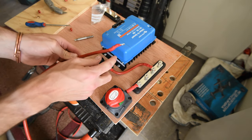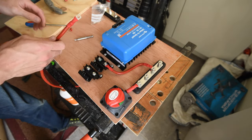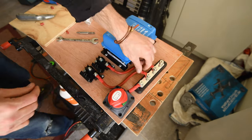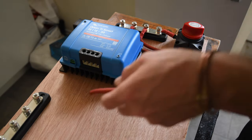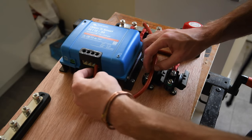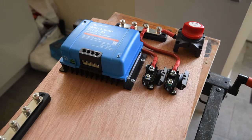Because these components sit quite high, I'm bending the lug a little bit so it fits in nicely. First set of cables done — pretty happy with that. These are my little fuse boxes, and this one is going to fuse from the positive out to the next component, so let's get that one wired up.